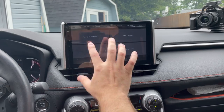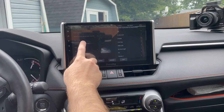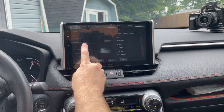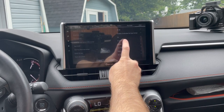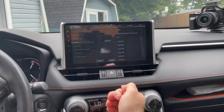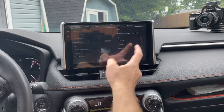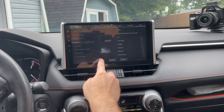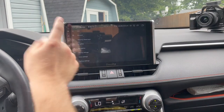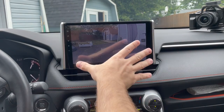You can do some key settings as well. Over here on Other, if we scroll down, we have front camera set to on. And then switch to front camera after reverse — 6 seconds. I can click on this and change the amount of time I want the front camera to display after coming from reverse. I have it at 6 seconds, but you can go down to 1 second. I found that 6 seconds is plenty. Then click Apply and exit. That's how you adjust the timing from reverse to drive and then see the front-facing camera.